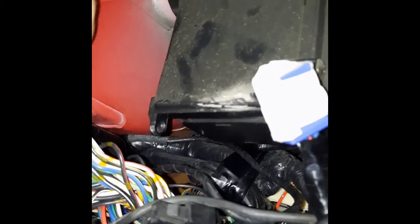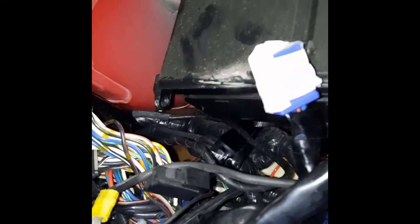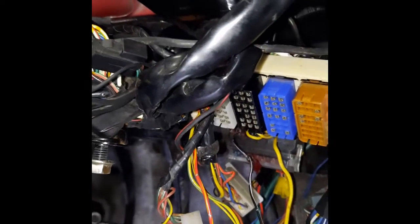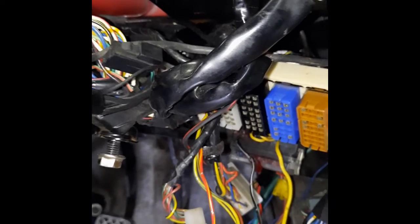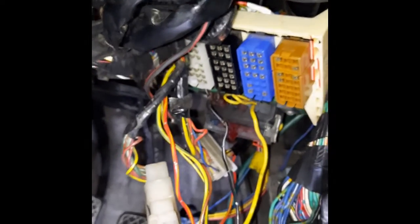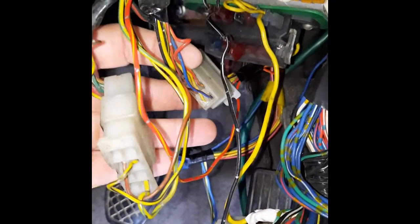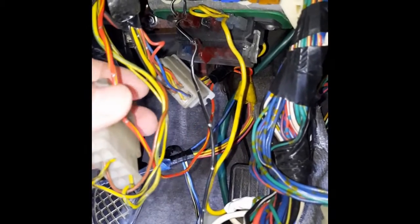So the actual Liberty loom, if I didn't have all these up in place in here, whoops, the actual Liberty loom is that one tucked back in there. It doubles back on itself. But like we said at the end of the day, the last wiring diagram I did with the 6 wires was 100% correct. So the wiring coming off these two ended up basically being 6 wires.